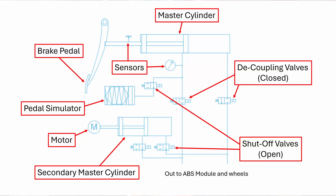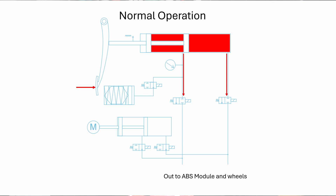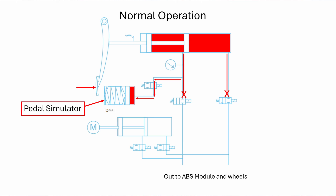Let's look at a schematic diagram of the inner workings of a typical decoupled system. The brake pedal is connected to a fairly traditional looking master cylinder with two pistons, just like in every other car. The hydraulic fluid coming out of these two pistons goes through two valves, which are normally open, and flows out to the wheels via a traditional anti-lock brake module. What makes these systems different is that when everything is working normally, those two valves are powered closed, which means the hydraulic fluid coming out of the master cylinder has no way of getting to the wheels. Instead, the fluid goes into something called a pedal feel simulator — a device made up of a spring and a rubber donut that get compressed by the hydraulic fluid acting on a piston. The idea is that the rubber and spring compress in a way that feels to the driver like a normal brake system.